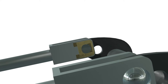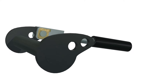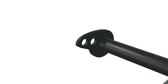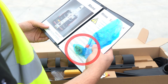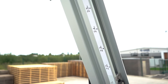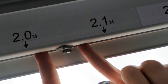To adjust or remove the gas ram, undo the clevis clip which holds the gas ram pin in place and either remove the pin or reinsert it into the required position, using the clip to hold the pin in place. Spare brass bushes that sit alongside the pin can be found within the user manual wallet if needed. The drop down height scale is located on the underside of the system. The correct drop down height setting for this van is 1.9 meters, which is altered by moving the height adjusting bracket as shown.